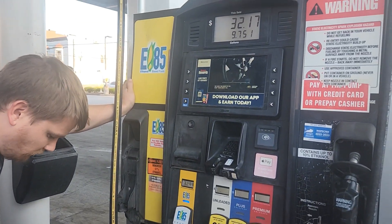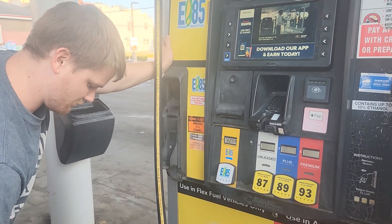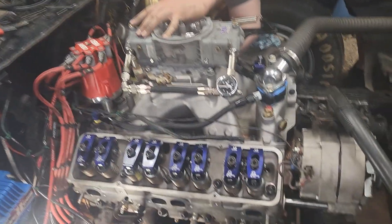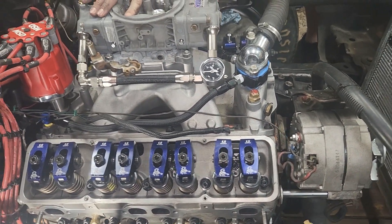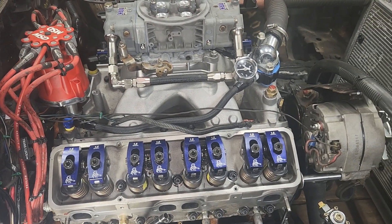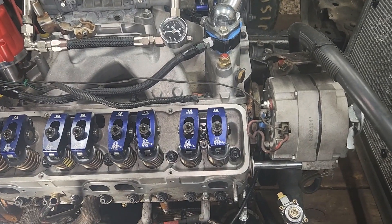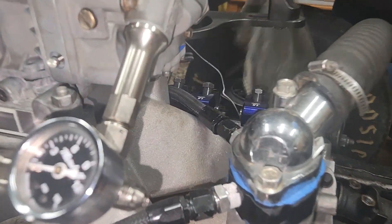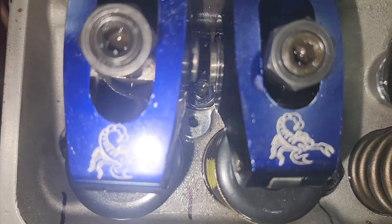Once we get the carburetor on, we're just going to stick the hose that went to the tank down in one of the jugs and see if it'll start up. I still need to finish the head studs, put the valve covers on, put oil and water in it. All right — the head studs are all done. Boy, that was time consuming, but I tightened them all the way up this time. Chris has got the carburetor on and the carb spacer did clear the 50cc pumps.